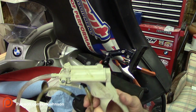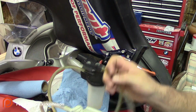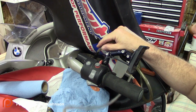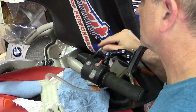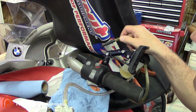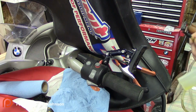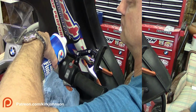Okay, the only time I use one of these on this job now is right now, just to vacuum out the old brake fluid in here, and I take it just down to where it almost contacts the hole at the bottom. I don't want to do anything whatsoever that could introduce any air into the system, so we'll be very careful to not introduce air.